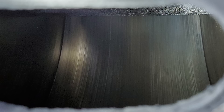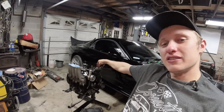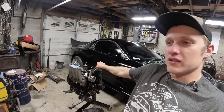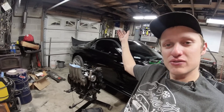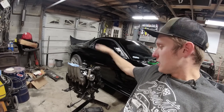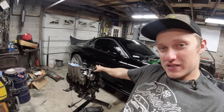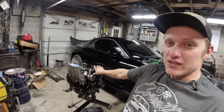The thing that I love — and I will show you the pictures of the inside of this engine — is yes, these iRotary apex seals are hard. I think they are the contributing factor to the majority of the wear in this engine. The other thing is the cleanliness of the carbon buildup in this engine is awesome. The bio-rotary pre-mix burns super clean and seems to lubricate really well — I see that in my RX-8 as well. But I do think when you're going to run a harder seal — the iRotary seals, the Rotary Aviation Super Seals — you're going to need to up the pre-mix from one ounce per gallon.